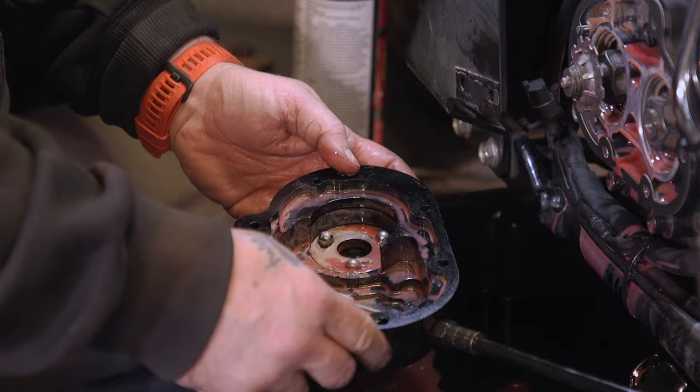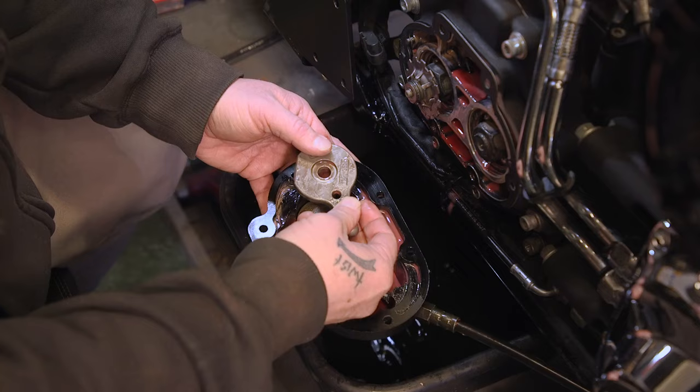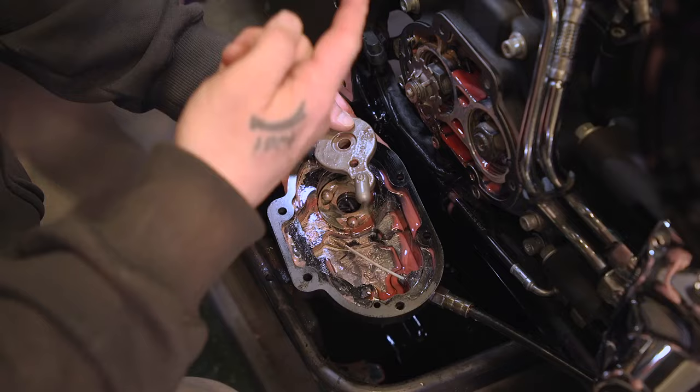But I figured I'd kind of show you guys how this works. This is a ball and ramp mechanism here, and when you pull your lever, your cable gets pulled this way, and it moves this whole assembly like this, which then expands and pushes on this little unit here, which pushes the clutch open on the other side. So when you go to put this back together, you may have a lot of pressure here, and you may need to go and take some of the pressure off on the other side. And I'll put the link in the description to the clutch adjustment video that will show you how to make that adjustment on the other side.